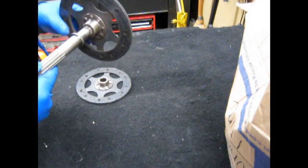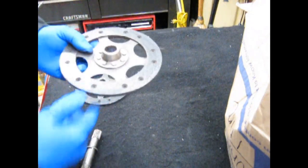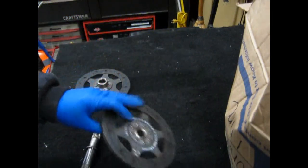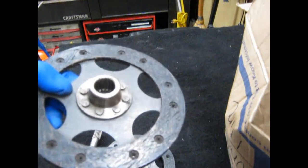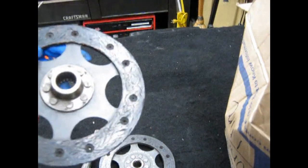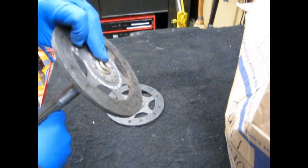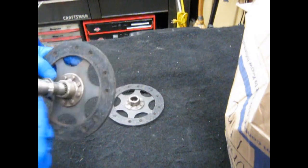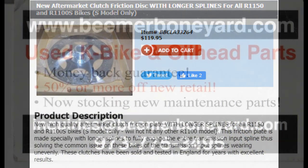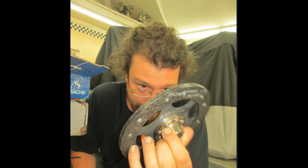Some have made it over 48,000 miles and just had distorted splines. It strips out — the teeth are gone on the end where they were engaged, except on the end where they never went in because the shaft never reached that far. What needs to be done to prevent this is to move the disc all the way back onto the shaft where it's supposed to be. You can achieve that by putting a spacer in and moving it back. You can obtain just such a clutch disc from Beamer Boneyard, similar to what Bruno used to make for his modified disc.